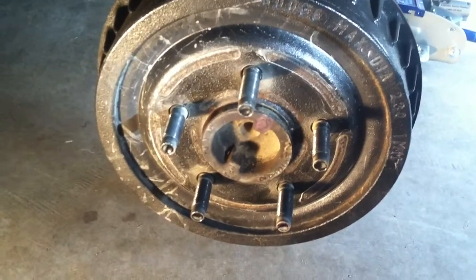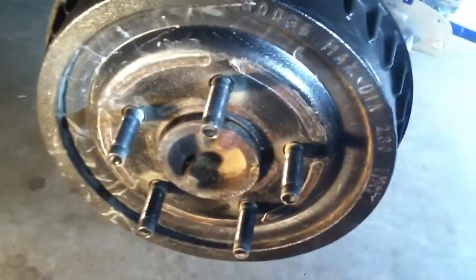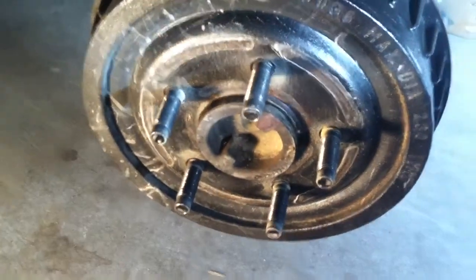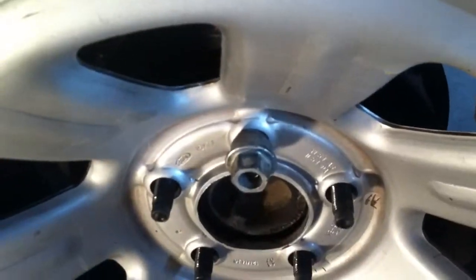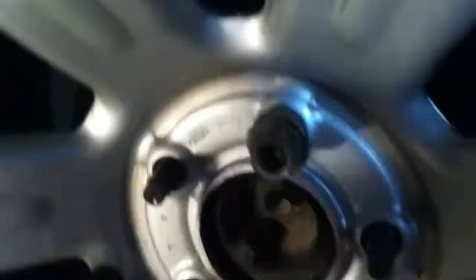It's pretty self-explanatory, but a general rule is keep your legs out from underneath the vehicle because if something fails, you don't want to get hurt. I'm going to go ahead and mount these up and start tightening the lug nuts back down. When you're putting these on, make sure you put them on in a star fashion even when you're tightening and torquing them down — for instance, I'll tighten this one, then go to this one, then this one, then this and then this. That ensures you get good weight distribution over the entire hub or in my case the brake drum.